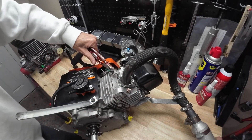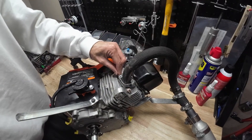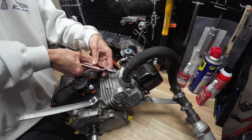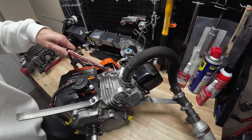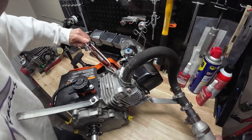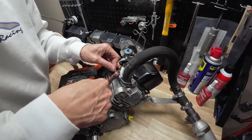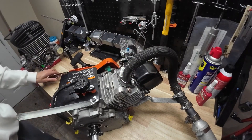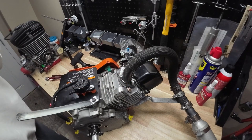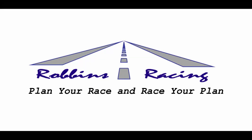Pull it through tight with our pliers just like that. Finish this off with a few twists, cut off our excess, and again just make sure you tuck that little barb out of the way so you're not getting cut up on it. Job is finished — that is how you're going to want to safety wire your exhaust header bolts. Thanks once again for watching my videos, and have a good time at the track. We'll see you next time.